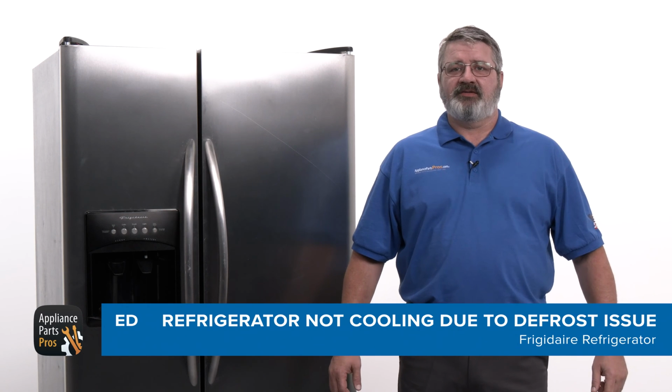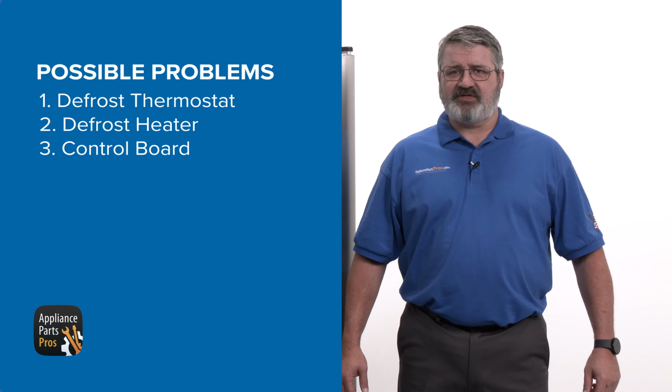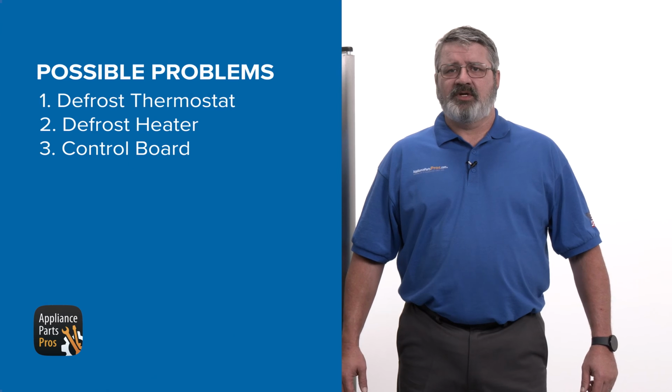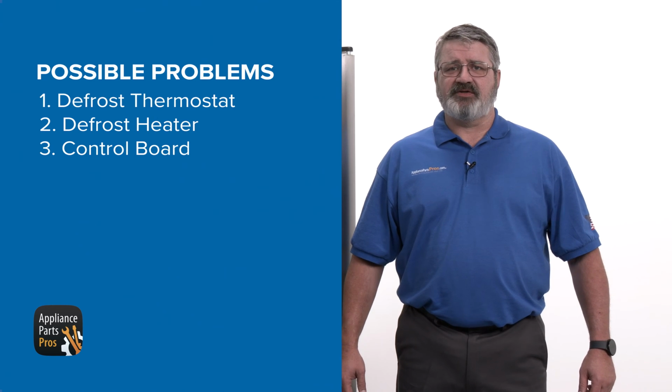Hi, I'm Ed. Today we're going to find out why a Frigidaire refrigerator isn't cooling in the refrigerator section. When this happens, it usually means there's a defrost issue. So the problem would be related to a failing defrost thermostat, defrost heater, or a control board. In most cases, you'll see a heavy frost buildup on the back panel of your freezer compartment. Let's go through each step together so you can make this repair yourself.